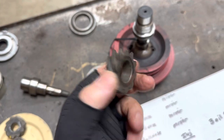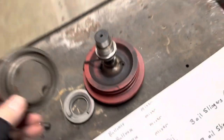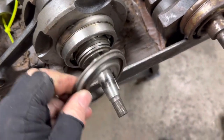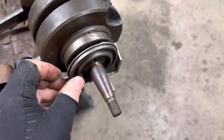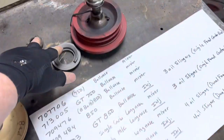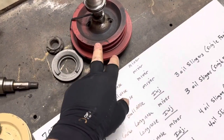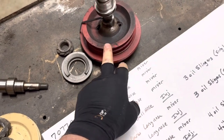This is the part that'll be on the front of the crank. Your GT and Monte Carlo cranks have two rings on the front, and this piece fits over that. This gets lost all the time — they're very rare, don't lose them. It's going to cost you a lot of money if you can even find them.